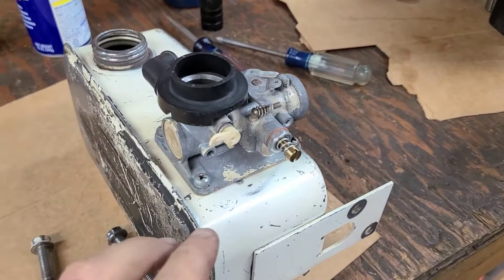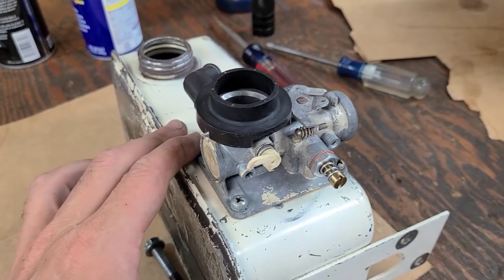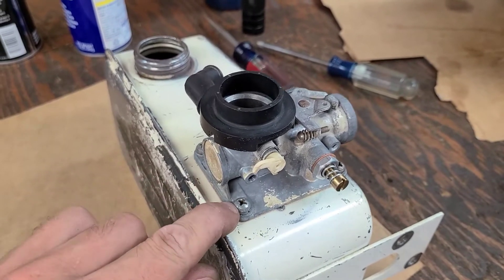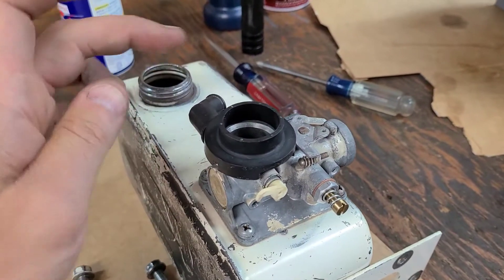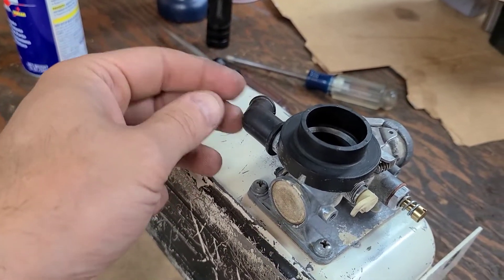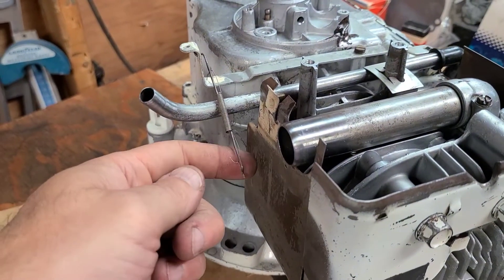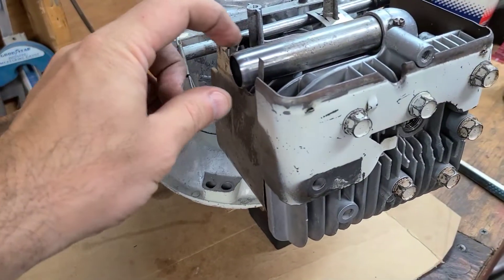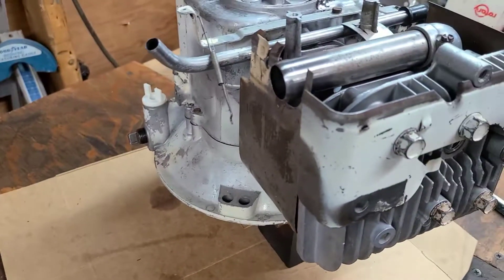Things are moving along smoothly. The carburetor is installed — just put the gasket on, then put the carburetor in being careful not to bind or bend the lift tubes. The three base screws are in place and snugged down with a screwdriver. The air horns are on there cleaned. I slipped the breather elbow in place, and put the throttle arm and throttle spring in place so I can bend it and start sliding it onto the intake tube. The seal has been lubricated with a little WD-40.